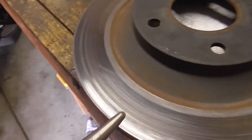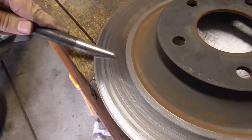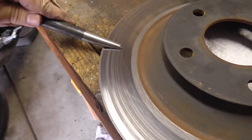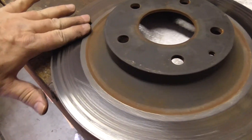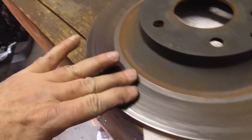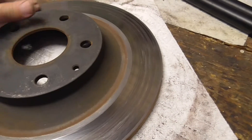We've been using a hand scraper to scrape it off rather than turn it and lose that nice hardened layer. Otherwise the disc is in good nick. Some of that you won't get done at a dealership — they won't do that, they'll just throw a new disc on.